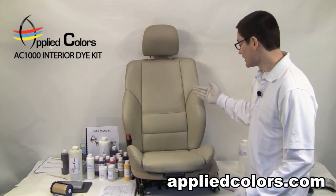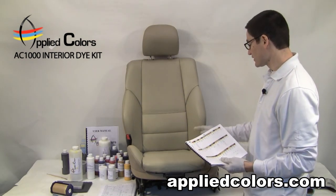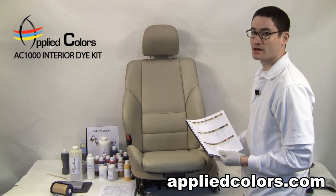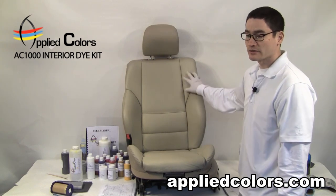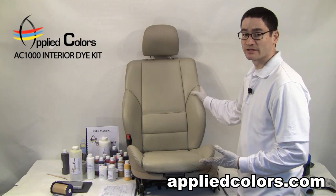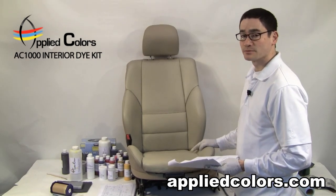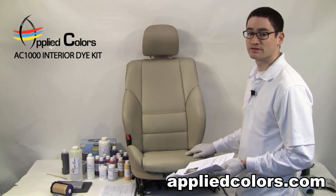You're going to clean it, scuff it, fill it, get your color match, and re-dye it. This really isn't very difficult because the hardest part is the color matching, and the factory booklet makes it extremely simple — you just match the year, make, and model of the car up to the formula in the booklet. I'd say that you could learn to do recoloring in about two to six hours. Get some parts from the junkyard, maybe a couple of seats and some door panels, and follow the instructions in the repair manual — it's extremely thorough. Practice on test panels, and within two to six hours you're going to have the confidence to take this service to your customers.